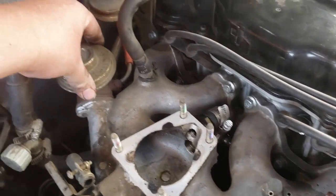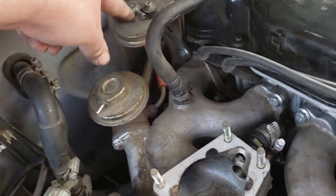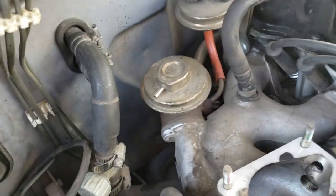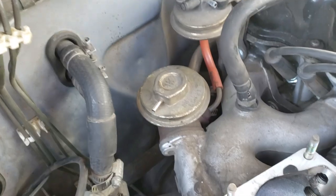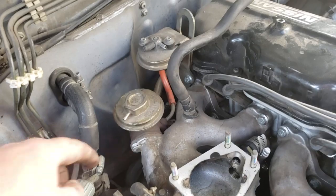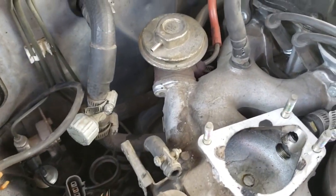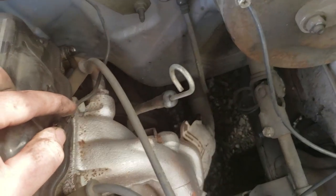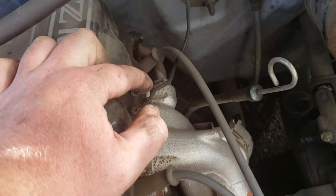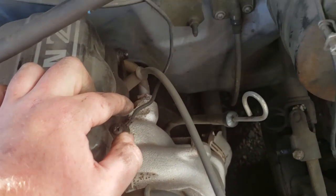Anyways, next up is going to be taking off the EGR valves. I think this is the main EGR valve, and that's like, I don't know, an accessory to it, because there's obviously one vacuum line that runs to it, so we don't need those. So we'll pull these off, and then we'll obviously have to make a block off plate for the EGR there. So we'll just get this pulled off first. And there's actually a tube that comes back around to the exhaust, so I'll see if I can undo that. Otherwise, it'll have to be welded up or something.